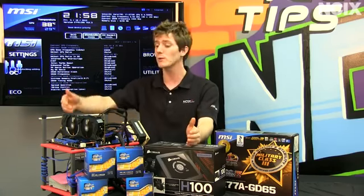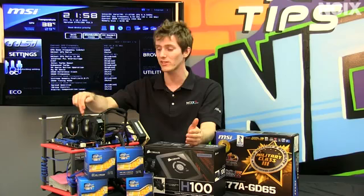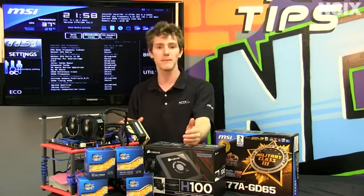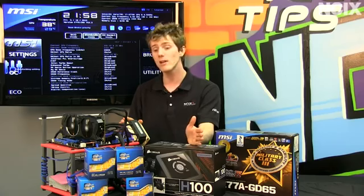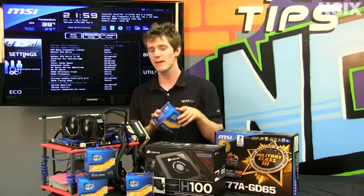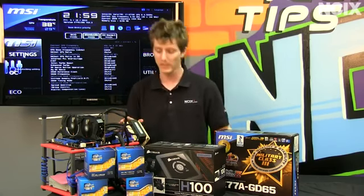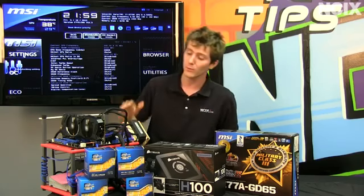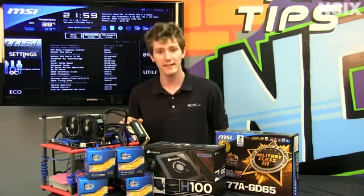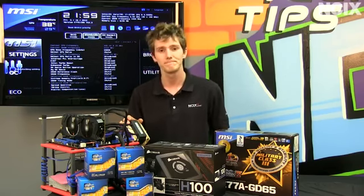Now, if you're overclocking the snot out of your Ivy Bridge processor, you're probably going to also want a decent graphics card. We went with a 7970, which also happens to be a very good overclocker, this particular Dual-X one from Sapphire here. And we went with Kingston HyperX memory. We're not going to be overclocking the memory much, though, because with its on-die memory controller, Ivy Bridge doesn't benefit that much from memory speeds in excess of the standard 1600 megahertz with CL9 latency. We're using a Patriot Wildfire SSD on our test bench, and a Corsair AX850 power supply because it's just awesome, pretty much.